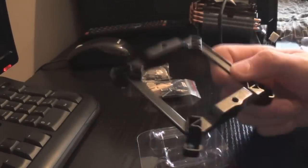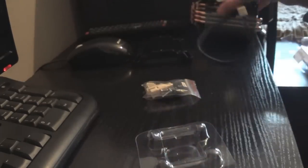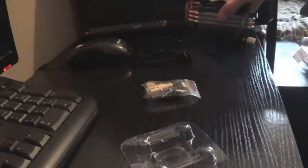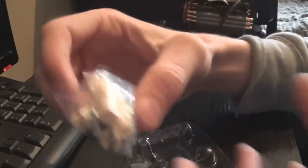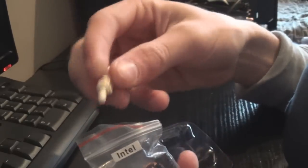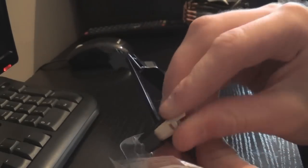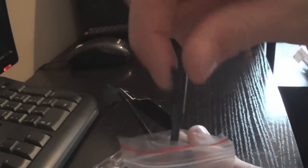This bracket is for the Intel board — you do not need it for AMD. Here's the AMD bag of parts; all you do is put two screws through the holes on the bottom and it tightens over the heat sink brackets on the AMD board. For the Intel board there are plastic lugs that push through to lock the bracket down to the board, and two screws which hold the heat sink further to the board.